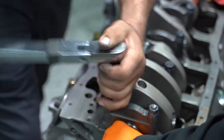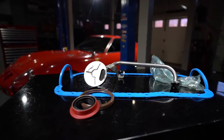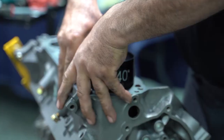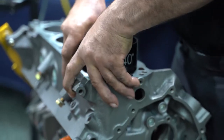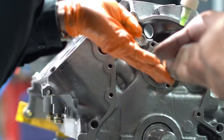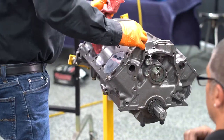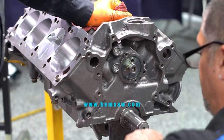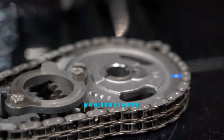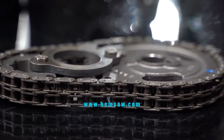This particular motor — we don't know what we're going to use as far as the oil pan. We have two options: front sump and a rear sump. Because we have an engine swap, sometimes you have to go over the steering rack and sometimes you clear it, so that's why we haven't put the oil pan on yet. As far as the front cover goes, we don't know what kind of accessory system we're going to use because we don't need power steering — we're going to be using electric power steering. We really only need AC because Doug wants to be cold in the summer, and we're going to have an alternator, so we want to use the correct water pump to go with our timing cover. Then we're going to do a nice intake manifold, nice valve covers, and we should be good.